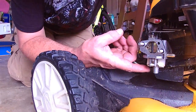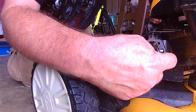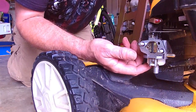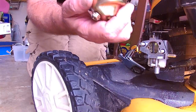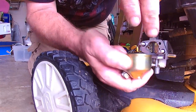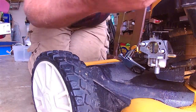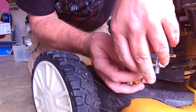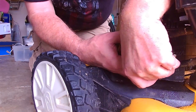Your float is right here. In the down position, if I blow into that I should hear air, and then when this goes up and closes you should stop your airflow of blowing. No — you don't. This is why I want the carburetor off.